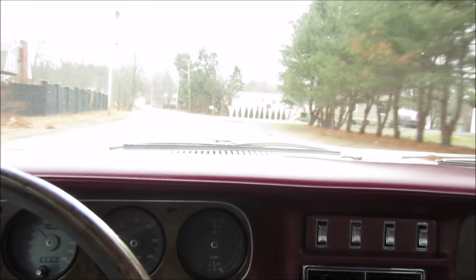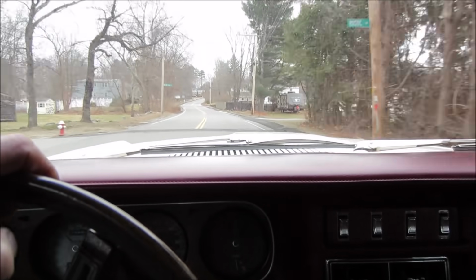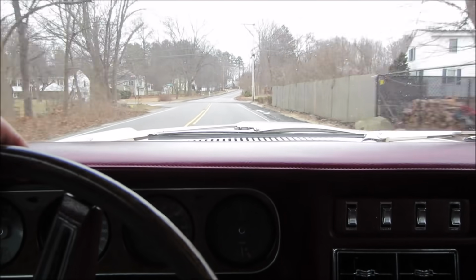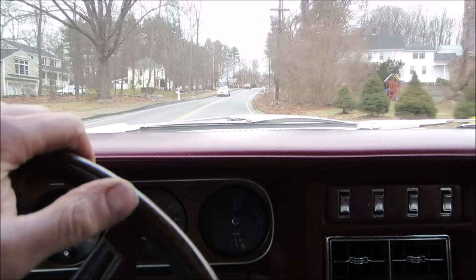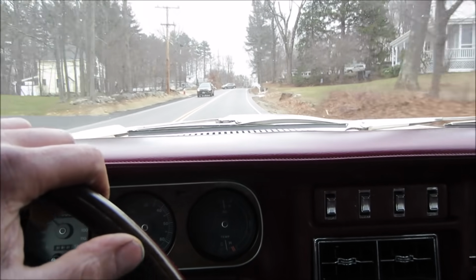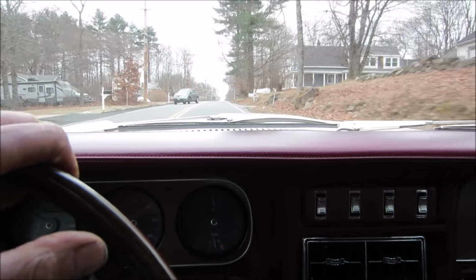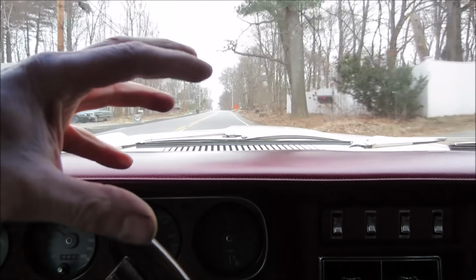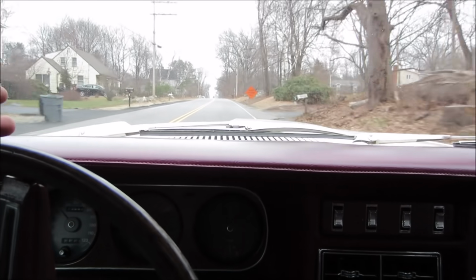I do think we've got a transmission issue. He said he had it sent out and had it done. Apparently, he didn't do a very good job. It has all the gears. I don't see a problem with that, but what would grind? Essentially, it's a bunch of bands that tighten up on different circuits. Clutches that slip, torque converters, nothing in a torque converter that's going to grind.